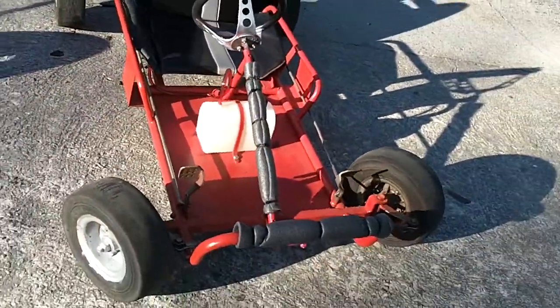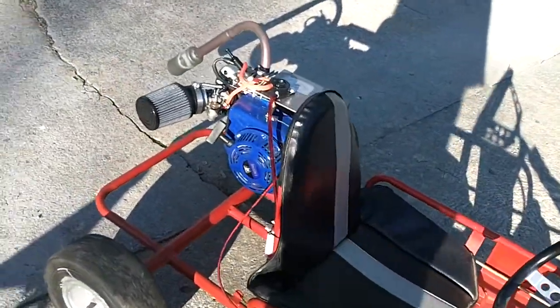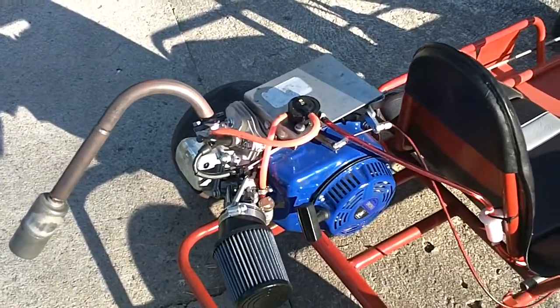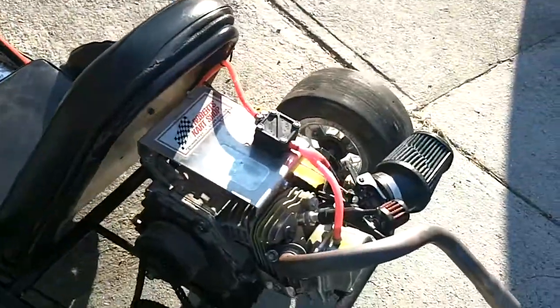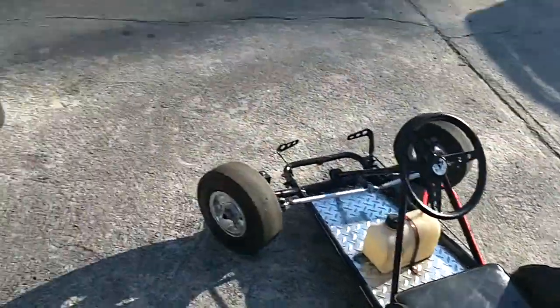This is my Streaker go-kart — just your standard classic go-kart. I wanted one like I had when I was younger, except I put a GX200 clone on it. It's got a header, air filter, throttle plate, and 18-pound springs. That sucker screams.